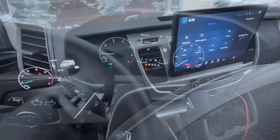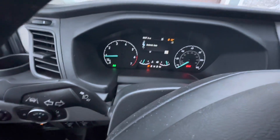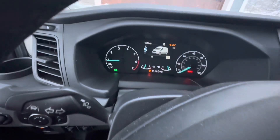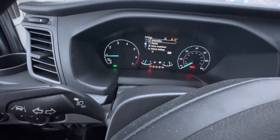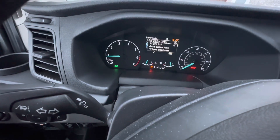Since I know this is gonna be a little bit tough of a drive to get out of here — being nine inches deep and unplowed — I'm gonna go ahead and turn off traction control. You want to come down to the one that shows a little picture of the Transit and the little cogs on the side, hit the menu key, and go to Driver's Assistance and Traction Control.